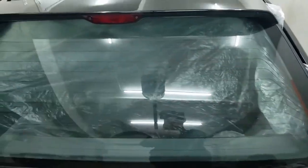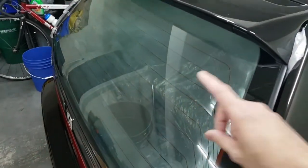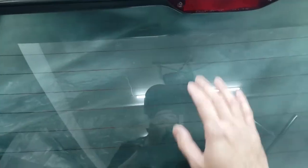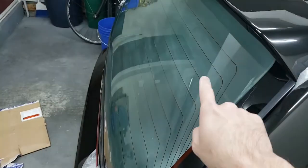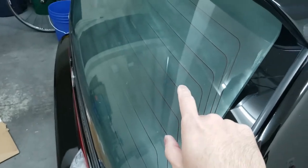It's already starting to fog up in there. You want to put a sheet of plastic — I just let it sit outside — so that it blocks it off from this area only, and a bucket of hot water. This will just keep creating fog and condensation steam inside this area. You can see it's really fogging up, and then once it's fogged up enough, you're going to go inside the car and basically run the defogger. This way you can determine which of the lines are actually broken. On an angle you can see it is really foggy now.